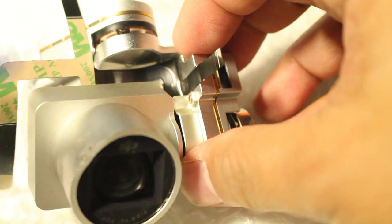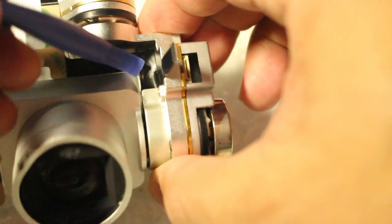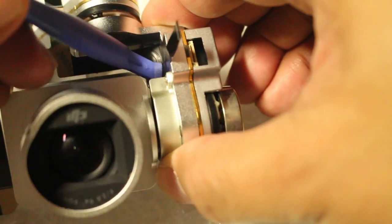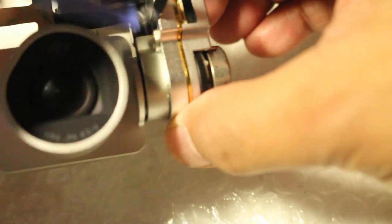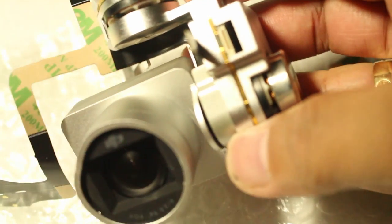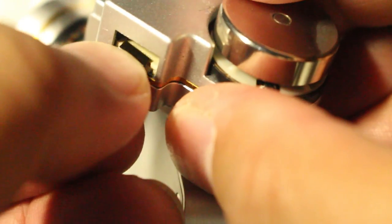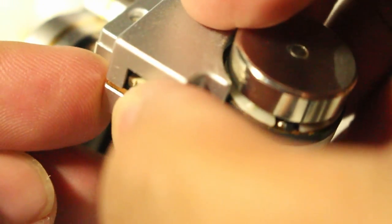Okay. Stick it carefully using this one. It's properly rested. Leave it here. So make sure it swivels freely. Now it's using the plastic. So don't use too much sharp object like metal, like screw, flat screws, or it may damage the flex cable. So this one would suffice. And then the contact point should go here. Put this clipping inside. Yeah, see the white line went inside.